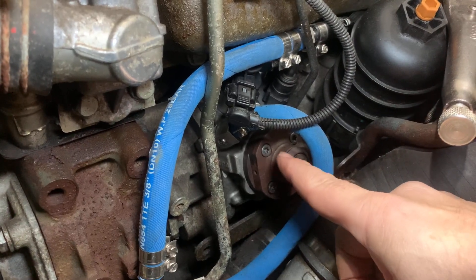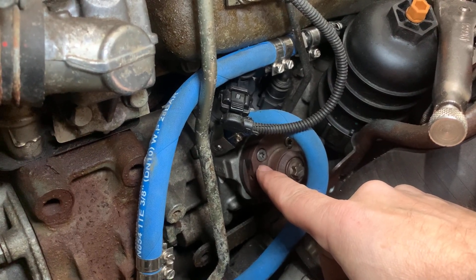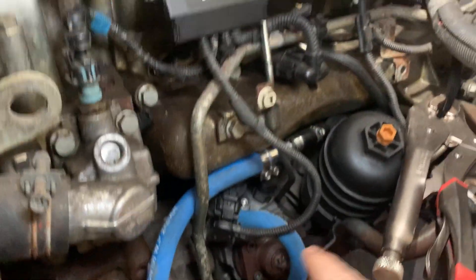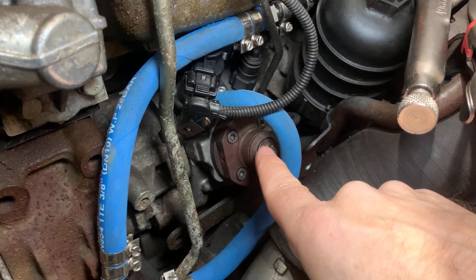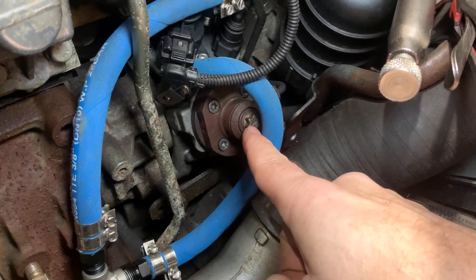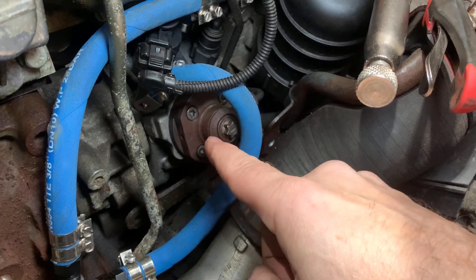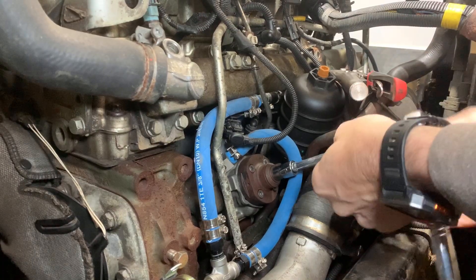This cap right here sits directly above the fuel delivery valve, which sits directly above the pumping element. If there's no fuel getting to the pumping element, it's not going to go out and up to the fuel rail. The fuel line backfills into the rail and back down to the output of the pump, so this whole thing should be full of fuel regardless. There's no check valve other than the fuel delivery valve, so if I remove this cap I'm going to see fuel from the rail coming back down. But if I take this cap off and remove the fuel delivery valve and there is no fuel underneath — maybe, just maybe, there's a little tiny airlock. This requires an E14 socket.